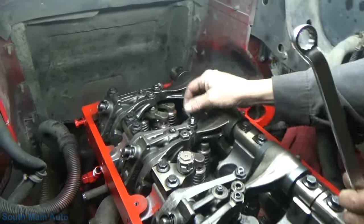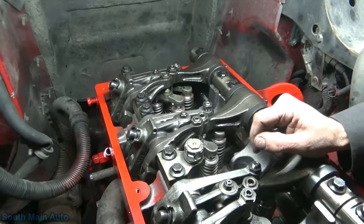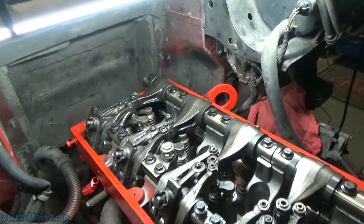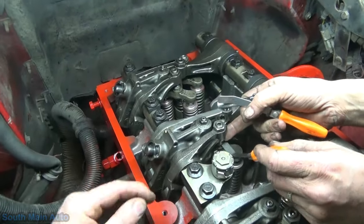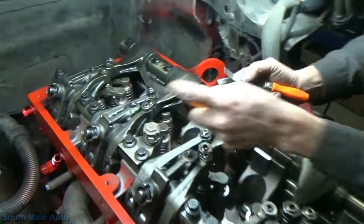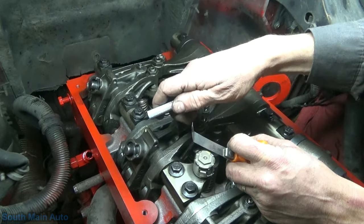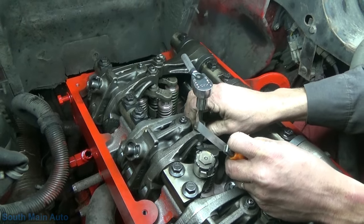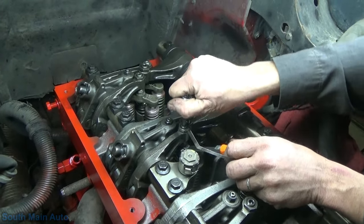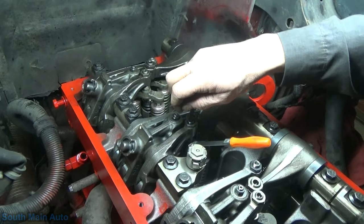This is also one of the cylinders with the bad lobe on the cam, so this is a new rocker — it's got three new rockers. At 14 thousandths for intake — it's going to be the exhaust or the one on the back side. Now this is our exhaust, so we'll do that one first at 27 thousandths. Sometimes the tappets like to stick. Just over-tighten slightly, back it off, little bit of drag.